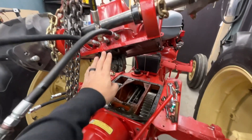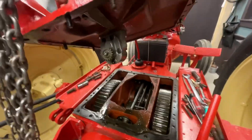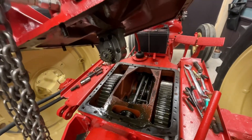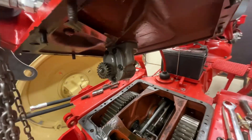On the bottom side of this very large cast iron plate, you'll see the pump. It mounts on the bottom — it's got the two ports, the suction port and the discharge port. Those go right up through the casting into the valve body. It's just a straight-up gear rotor pump. Nothing special.